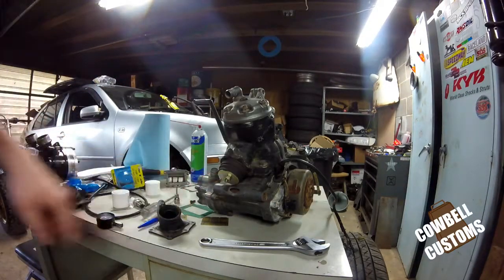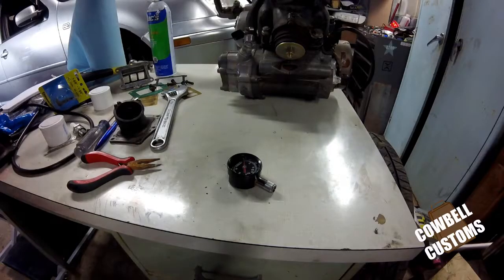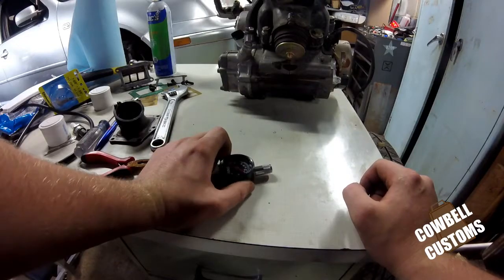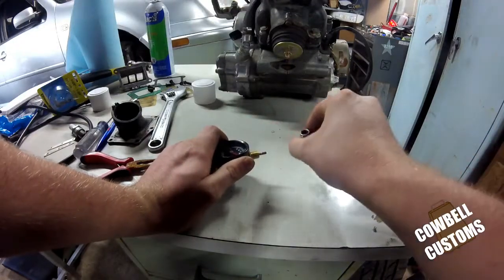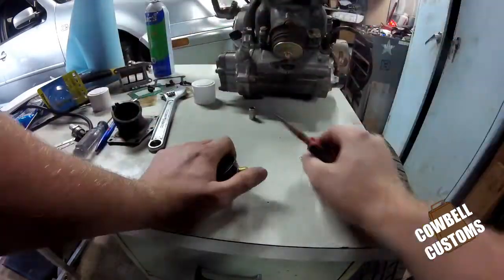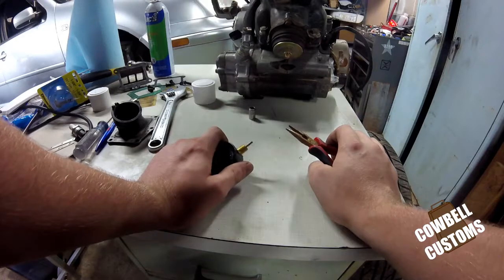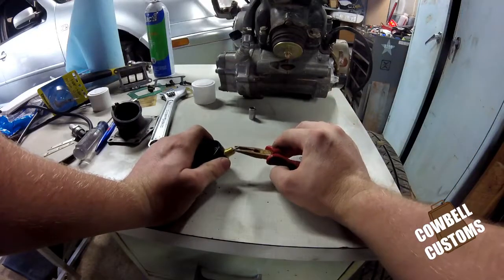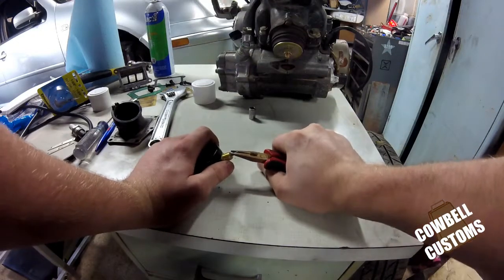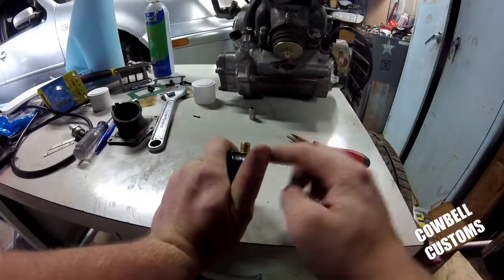Got the exhaust side butt plug — that was more of a pain in the ass than it needed to be, that rubber's entirely too stiff. We're going to prep the gauge to be put onto the caps. Take this, unscrew this little doodad, throw that away basically. Grab your handy dandy pliers — this is the piece that pushes the Schrader valve down on the other side on the tire, then you can obviously read the air pressure. Take your needle nose pliers, firmly grasp it, and then give it a twist and a yank. A little pin will come right out, and now conveniently that's nice pipe threads.